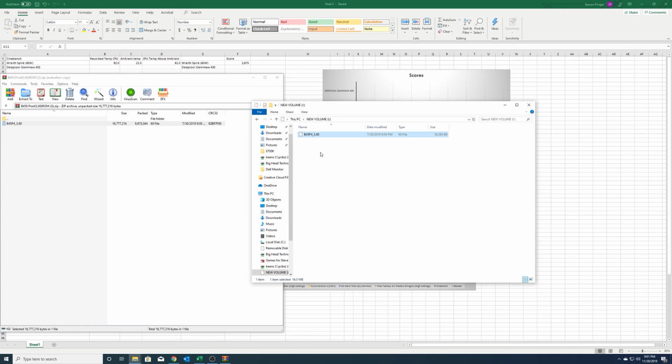Then all you have to do is reboot and go into your flashing utility. That will vary from motherboard manufacturer. You will select the flash drive, this file. It's ideal if this is the only file on the flash drive. Let it flash. Do not reboot it. Do not turn off. Let it do its thing, or else you will brick the whole board and it will become useless. Once that is done, we can go ahead and take out the old CPU and install the new one. So let's take a look at how that's done.